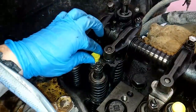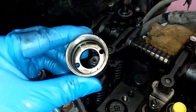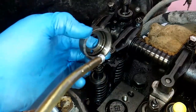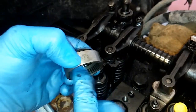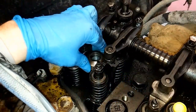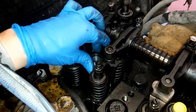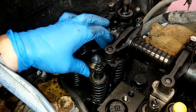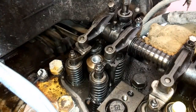Next step — remove the little plastic cap from the nozzle. Then you're going to install the retainer. The retainer has a torque spec. There's no seal or anything for the retainer; I put a little oil on the threads so nothing galls and you get a good torque reading. Install it hand tight for now. It should thread on without the tool — if not, you probably have damaged threads.